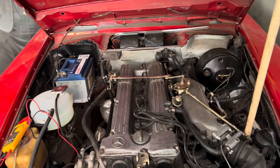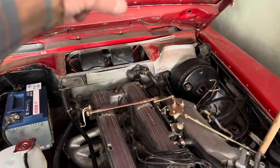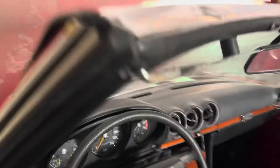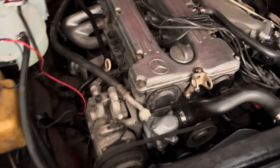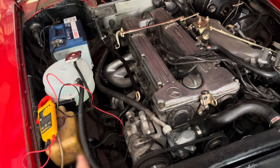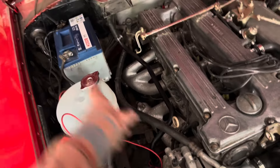If you find you're only getting 13 or 14 volts across the battery when you put your foot on the accelerator or increase the engine revs, check the exciter circuit — the blue wire leading to the red ignition light on the dash. When you turn the key and that red light comes on, you are sending 12 volts down that blue wire all the way to the back of the alternator, setting up a magnetic field. When the engine starts spinning, that magnetic field is cut by the magnets in the spinning alternator, inducing a voltage in the outer windings which then charges the battery.